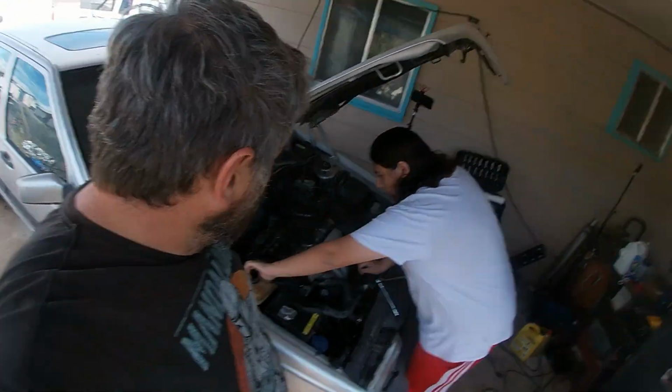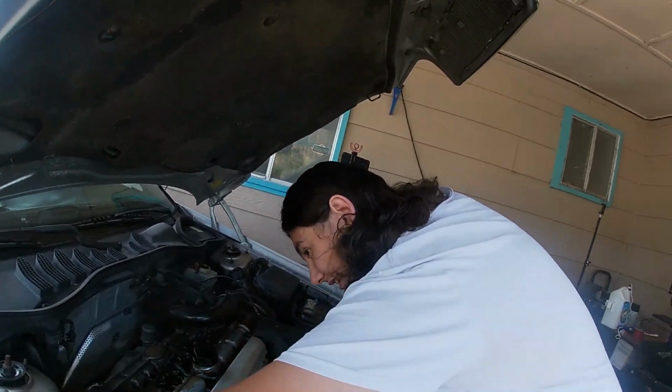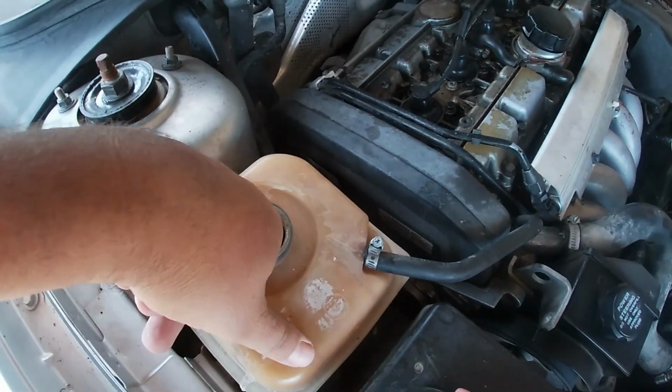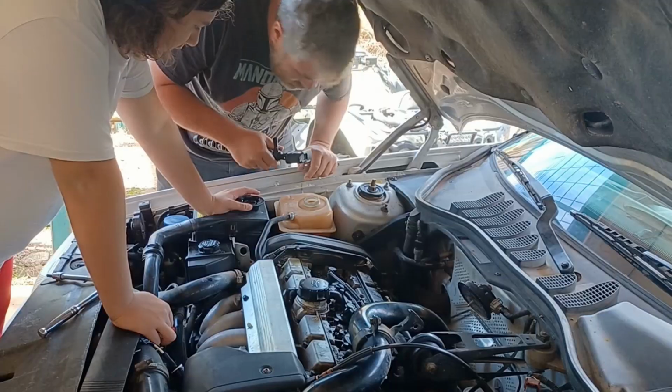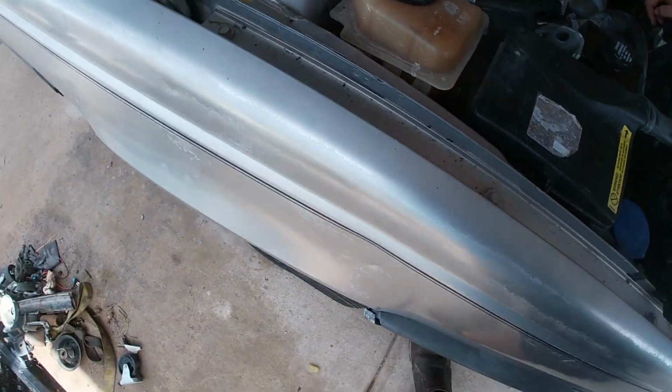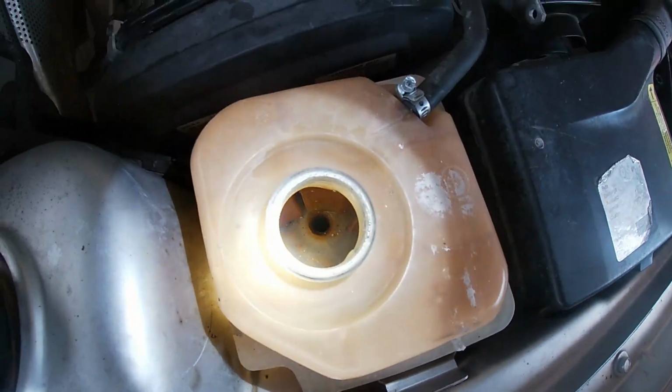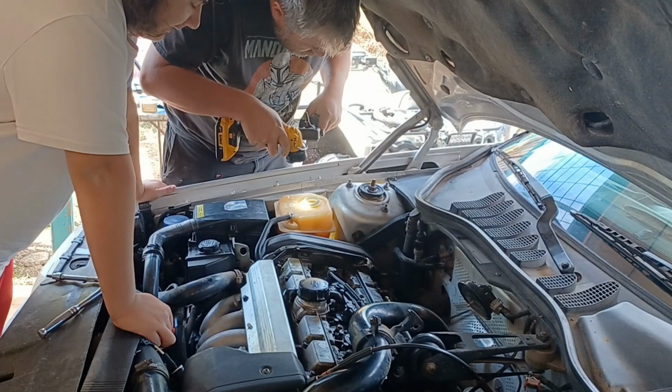So it should have been soaking wet if it overheated driving a block. So we're going on to the thermostat housing. Oh, that's drier than the Sahara again. No, the water's in there. Is it? Nope, it's not. Hold on. Let's shed some illumination on this situation. As I close the stupid cap. God! And it's out of water. And the cap's gone forever.